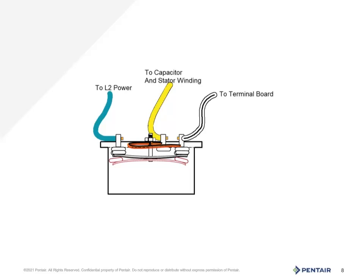The thermal overload is a heat sensitive disconnect. If the starting capacitor stays in the circuit too long or the motor is pulling higher than expected amps, the heating element will get hot and the switch will fall out of the circuit. Once it is cooled, the switch will automatically click back into position and be ready to try to run again once it sees voltage.